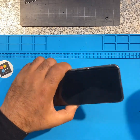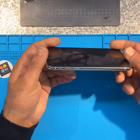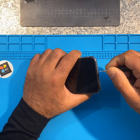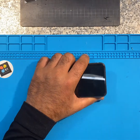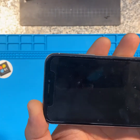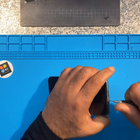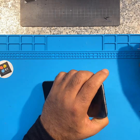So I think, honestly, for me firstly, it's not looking like someone opened it - meaning if you take it to shops down there, I don't think they opened it at all. However, it looks to me like it's a battery issue. Because I'll show you something - if you plug the charger in and wait for the logo to come out, then if I disconnect it, it goes off straight away. It's not staying on, meaning it's taking power from the battery. So what I'm thinking is wrong with it: the battery is disconnected or the battery is damaged.